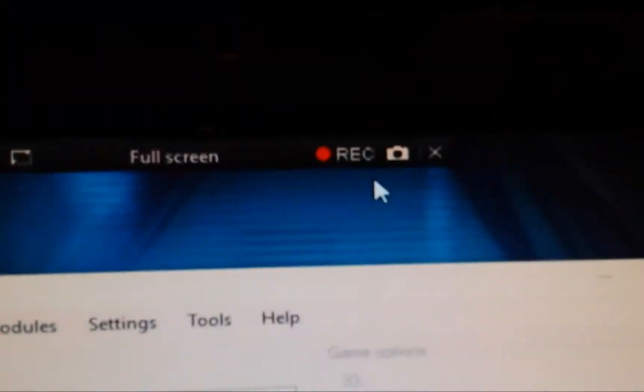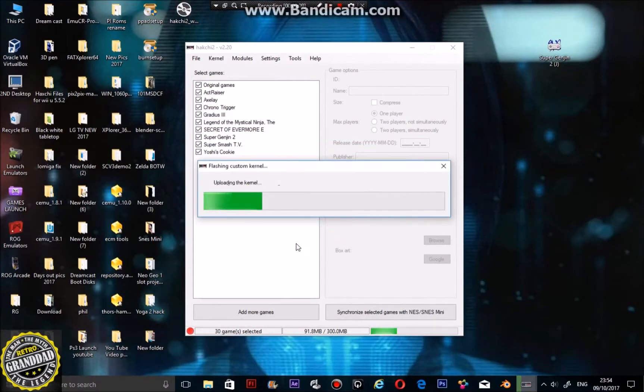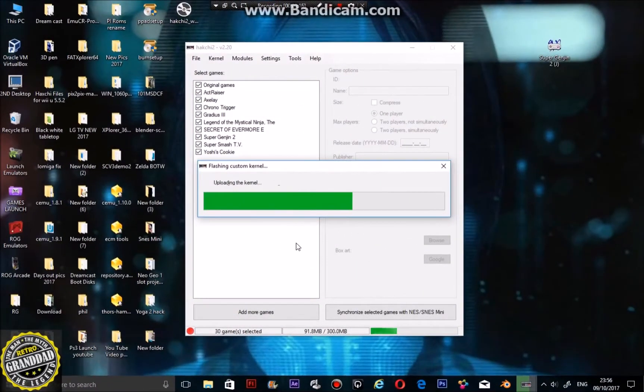Let's switch back to the computer now — this will give you a clearer picture. That's the same kernel we dumped out, so just save it again. As long as you've got your original firmware you don't have to worry about it messing up, because you can reinstall the firmware. The kernel is uploading — while it uploads, the power light stays on. The little dot is red, but it should go green when the machine is found. As you can see, the machine is found.